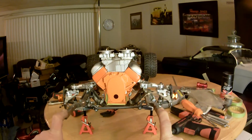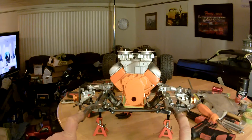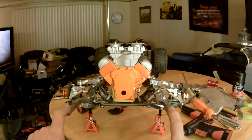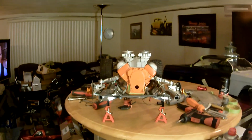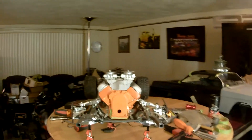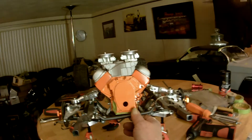There's going to be a center point where the body floats and the wheels only move slightly — that's your ride height. That keeps your stability when you're driving down a road at high speeds. When you hit some whoop-dee-doos, that's why the car gets all squirrely. When you land and all of a sudden you're jerking the wheel back and forth and you smoke the pole and the mailbox — now you'll know why.